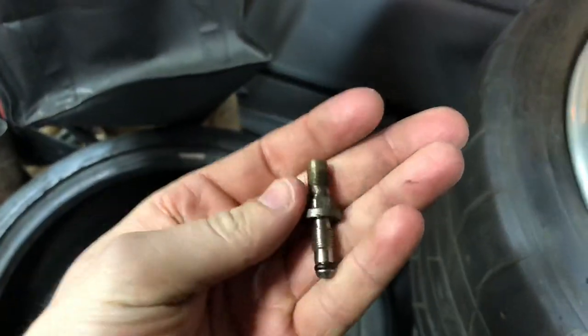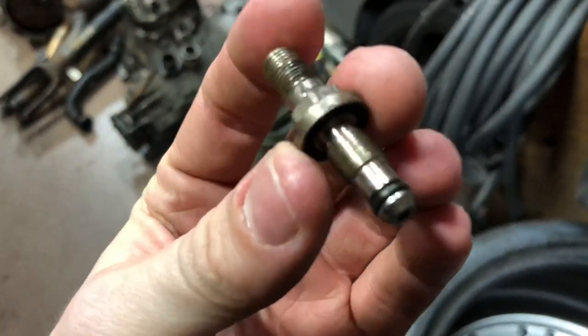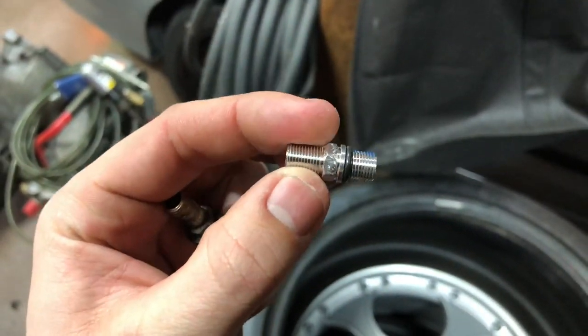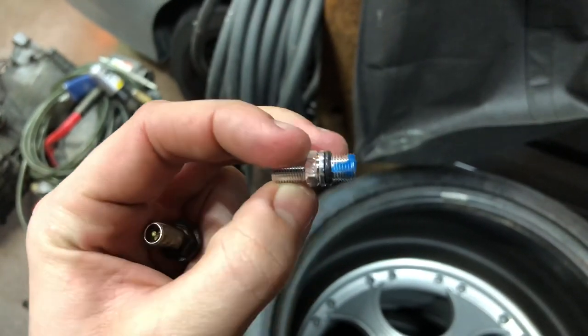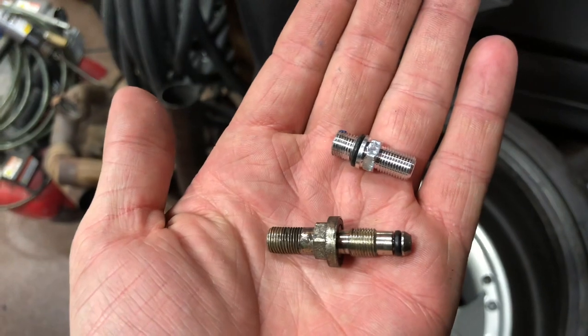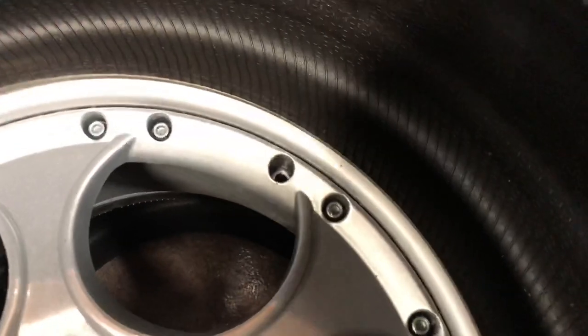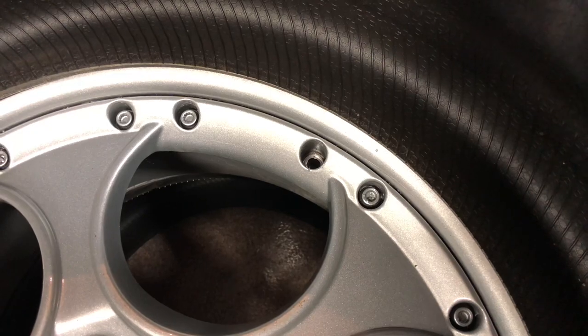When I got the wheels with the car they were disassembled, unfortunately, and it only had two of these. I looked into it and they are $327 a piece from Lamborghini — so, screw that. A friend of mine came over one night, we were drinking some beer, and he found these, which are for Fox Shocks suspension. They are standard Schrader valve aluminum, O-ringed, and I put a little bit of thread lock on there. These just happen to be the same thread pitch. You can see the Lamborghini one was much longer and has a secondary O-ring on it. However, I think the O-ring at the top will be just fine, because as these are bored down, what you're seeing down there is actually the rim of the wheel, not the face. The face is bolted on to it.